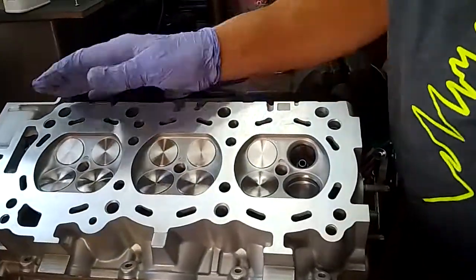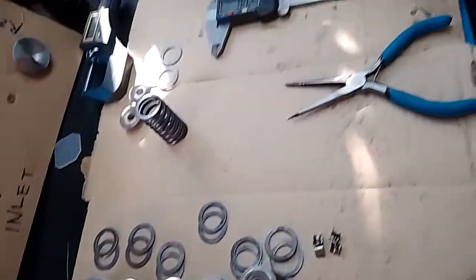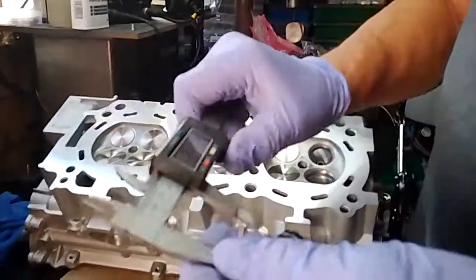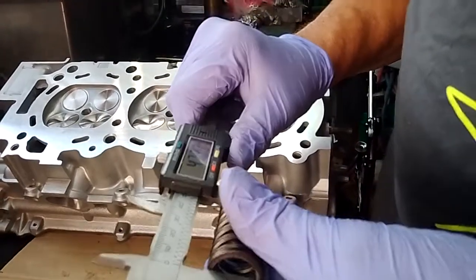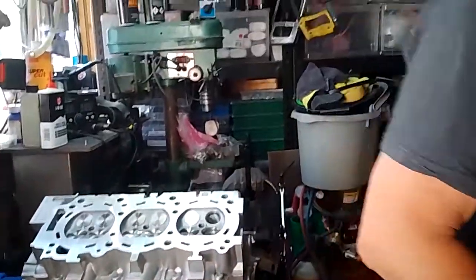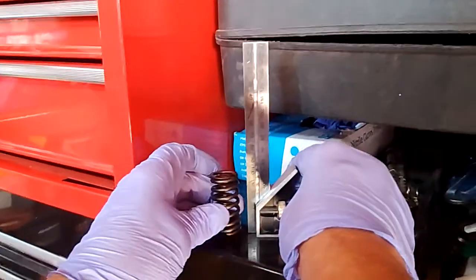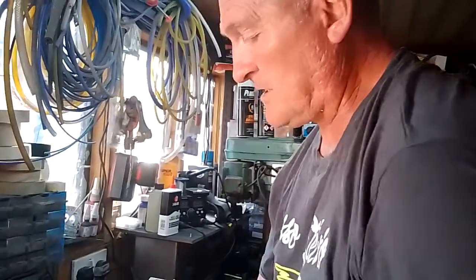First thing you want to do before you start assembling is clean everything. Everything is prepared, everything's been cleaned - collets, valve springs, spacers, everything is ready. I also checked the spring lengths; these are all around 46mm, ranging from 46.3 to 46.5. I've sorted the best ones out. It's very rare you'll get a duff valve spring - they're pretty robust. If you've been running lumpy cams, check they're square. The specification is no more than a 2mm gap at the top when set against a set square at the base.